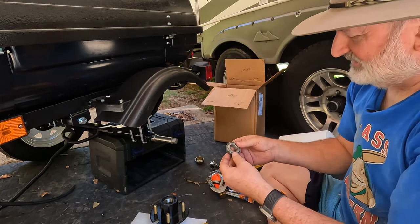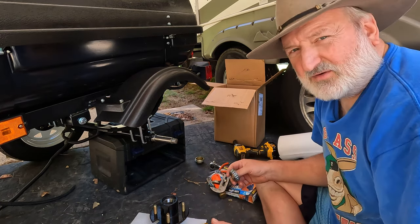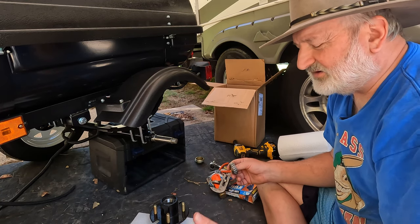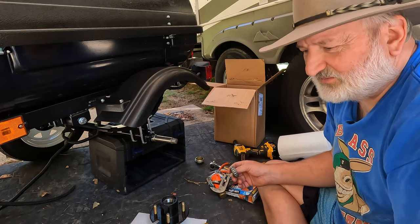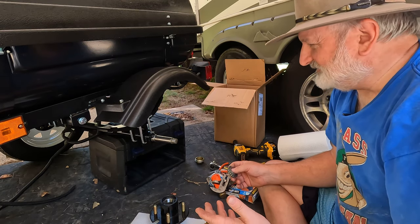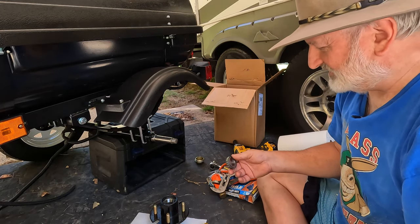30205 P6. And these may be fine bearings, but when I bought my trailer 5 years ago, everyone recommended updating the bearings. So I found a company that has bearings that seem to be an upgrade, and they've worked fine for me, and they're not that expensive. So I always replace the bearings on the Harbor Freight, and I'm going to do it here also.